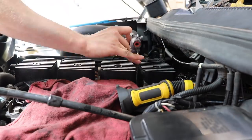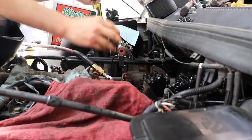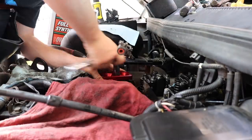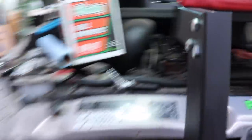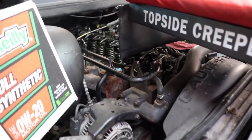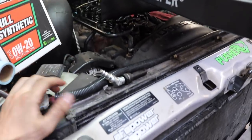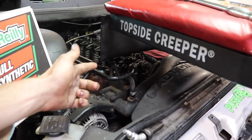Hopefully we can get this all done and get this truck fired up today — that would be absolutely fantastic. I'm going to show you what I got done so far. Both sets of valve springs are in cylinder six, three, and one. I kind of did three, then went to one, then went to six. I figured I'd start in the middle then go to the outside. I'm gonna do two next, then go back to five, and then four. I'm almost halfway done — I've done three out of the six.